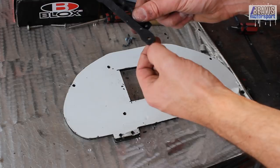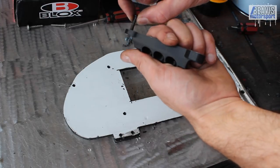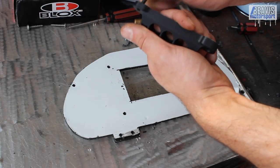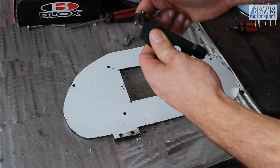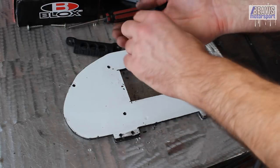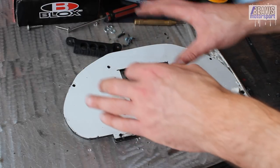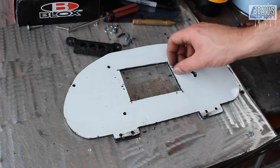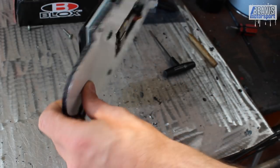I've tapped a thread into the holes in these brackets — it's plastic, not really ideal for tapping a thread, but it seems to work quite well. I'm pretty sure that'll hold. And if it doesn't, I suppose I can stick a nut on the other side of these bolts. I've got a couple of washers to give us a slightly bigger hole and a bit of wiggle room, which I think I'll probably need given the lack of precision we've gone through here. It's all mounted up now and it looks pretty cool, actually. I've got my bolts with my little washers on there. It's nice and tight.